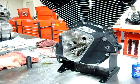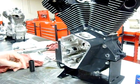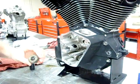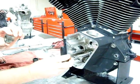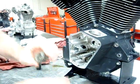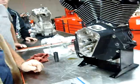So I'm going to have Charles here, this is his engine, come in. We're going to get our keyway slid in place. We're going to slide our pinion gear on first, the one that drives with the worm gear. Then we're going to get our final one on, then our nut, and we're going to torque this in place. So we'll pause the video while we go ahead and tighten that up.